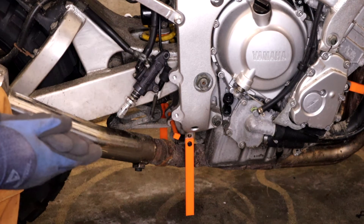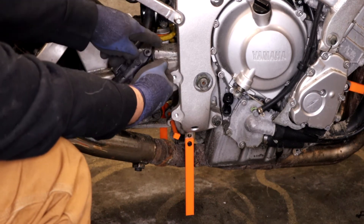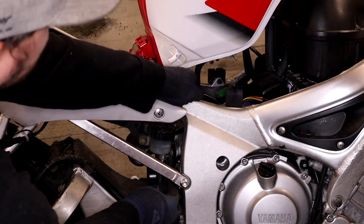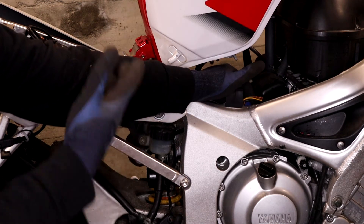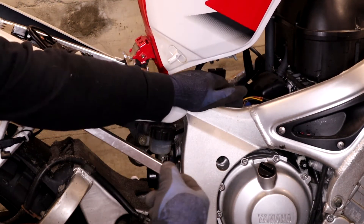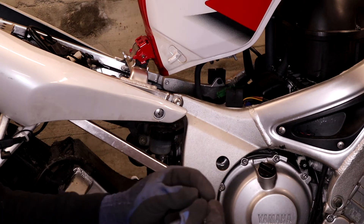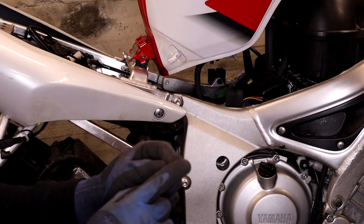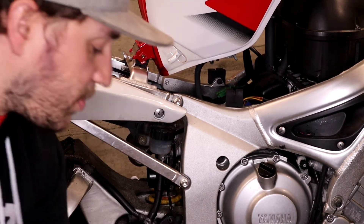That's your spring done. The next item is our sensor. This is the normal sensor and it actually runs from here up through here and down into a connection underneath the gas tank — that's one of the reasons the gas tank is up. It runs into a connection somewhere down here. The connection on the bike is not one of these style connections — it's kind of more of a standard fitting style, not these bullet fittings we see on this thing. So you are going to have to do a little bit of work to put bullet fittings on, but luckily it's pretty easy to get them.